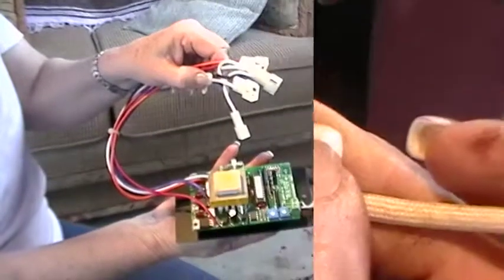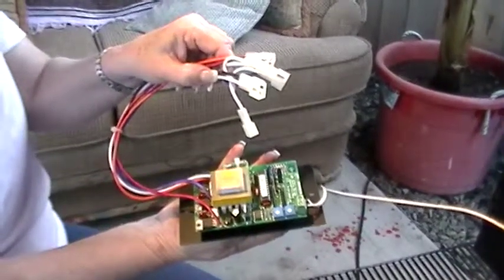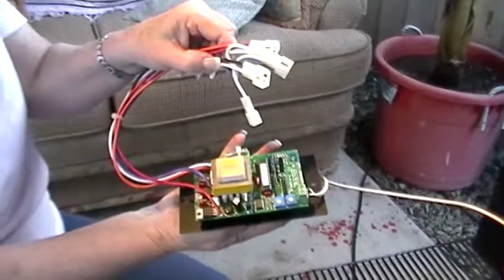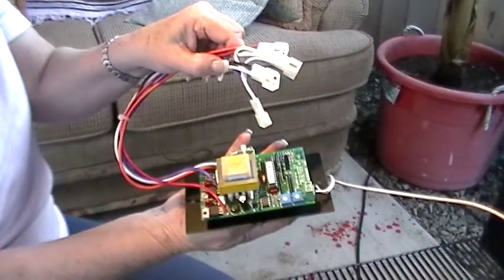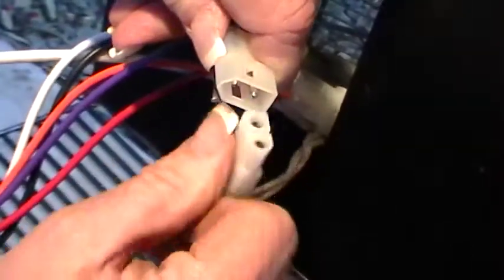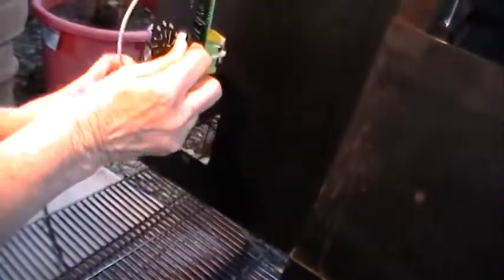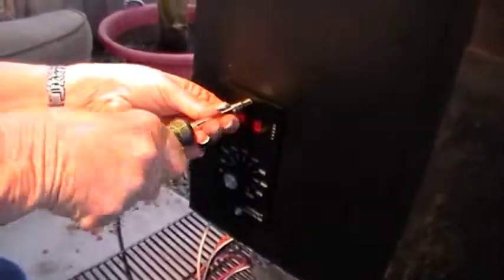There are four connectors on the controller that run all the electronics on the grill. They are color coded, but it is easier to replace one connector at a time — swap the old connector for the new connector — that way it's impossible to mix up the wires and get a funny sounding fan, etc. Notice that the connectors are keyed. See how they have the ridge in there, like the rooftop of a house? It means they can only go together one way, so you don't have to worry about getting them wrong. They snap together. Now all we have to do is feed the wires back inside, tie them up with a bread tie or tie wrap so they don't catch the fan motor, and tighten the screws. You don't have to crank them — just hand tight.